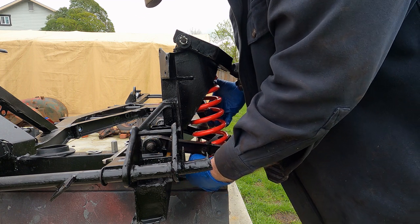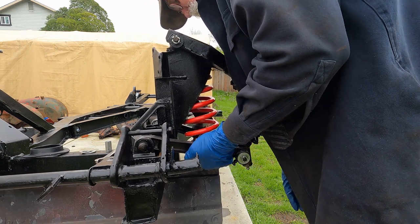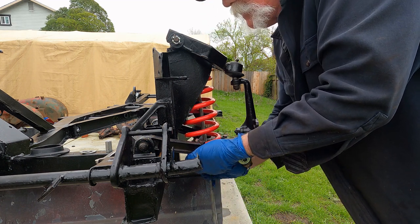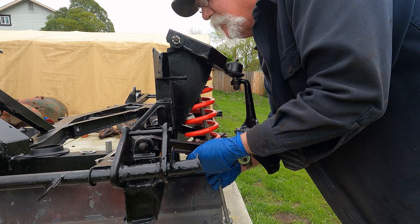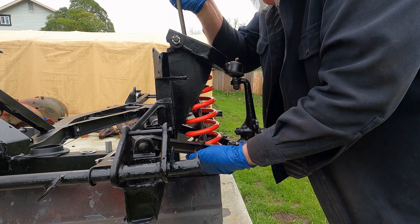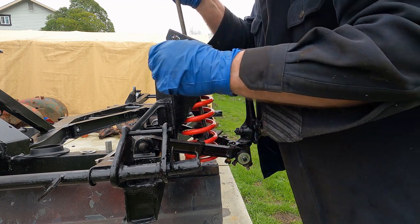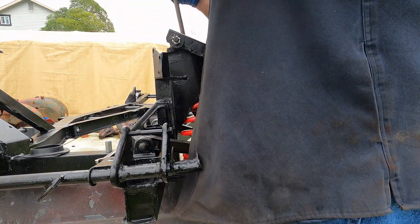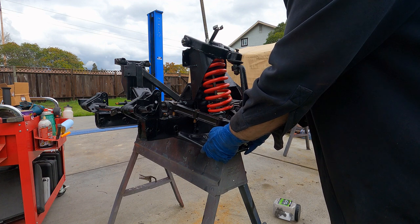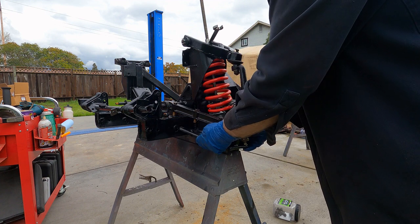I'm going to keep this plate pretty low in the spring. And you also want to make sure you have clear access from below. And you feed it through the top shock mount. You want to make sure you compress this enough that you can get this up and get your bolt started. And you want to get these two rears first because they're the most difficult, because they get locked in when that pushes down again.